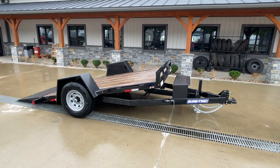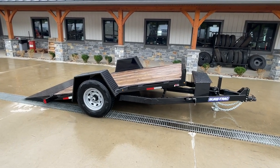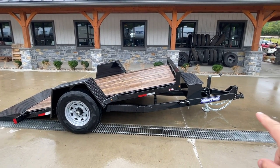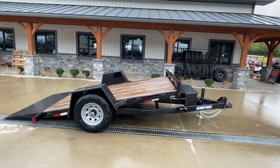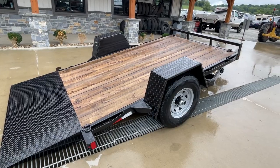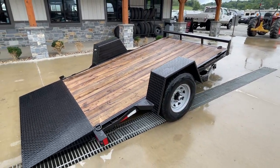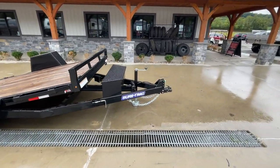This is a 6.5 by 12 — 6.5 feet by 12 foot long. It has a 7,000 pound axle. They're going to count 800 pounds of tongue weight and call this particular model a 7,800 pound GVW. Realistically, tongue transfer to the truck side via the ball up front is generally going to be about 15% or 1,000 pounds on this one. They've counted 800 pounds, so they're calling it a 7,800 pound GVW. Everything here except for the oak floor is standard equipment — the oak floor would be an option.